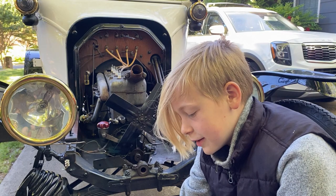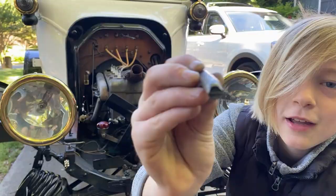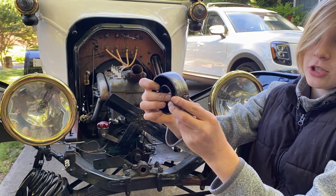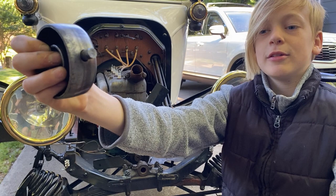When we turned it off we saw the fan belt was ripped. We looked down and the pin was broken. What had happened is the pin was in, spinning, and it stuck out just a little bit and hit the oil pan, which cracked the pin, and when it came out it also cut the fan belt.